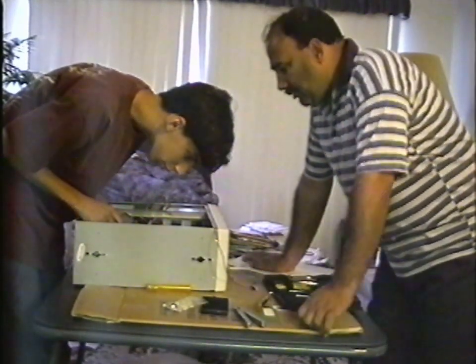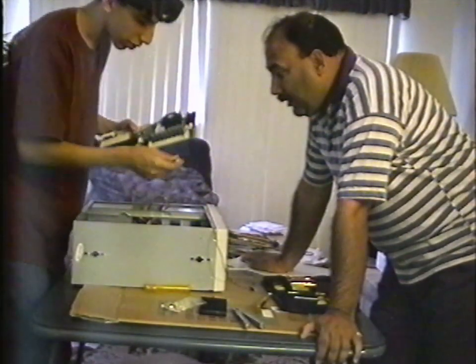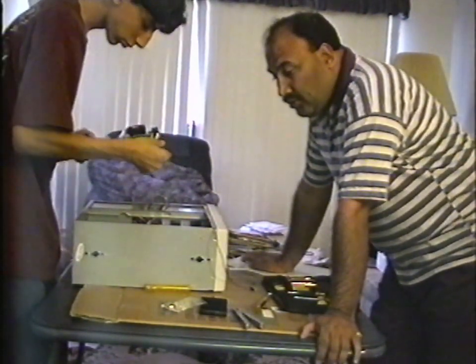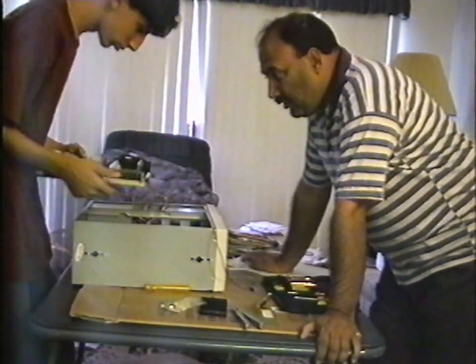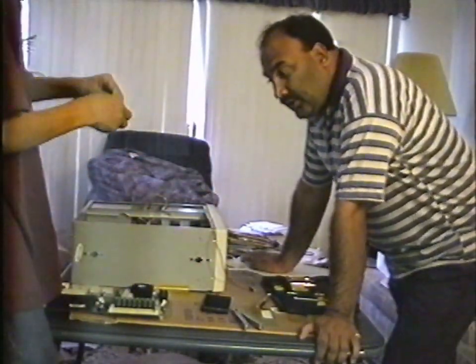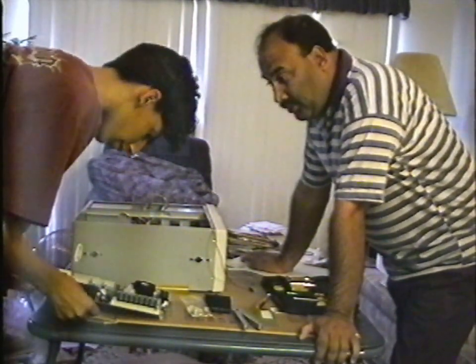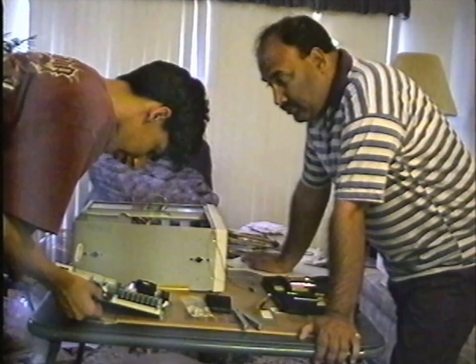And when you're assembling that, you have to be very cautious about it. Make sure you don't have static electricity, which can be produced by walking on the carpet, can short out your whole board, and can destroy your motherboard or CPU both. It's a very electrostatic sensitive device.